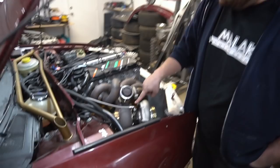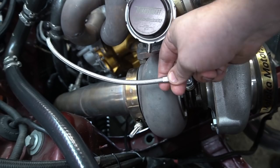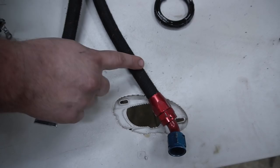But there is a benefit to professionally swedged, really badass lines. Like we talked about in the last episode, especially oil feed lines, you get professionally swedged. It also has a smaller silhouette, versus these fittings that are larger, meant for you to make your own lines. Just keep in mind, that's the difference.